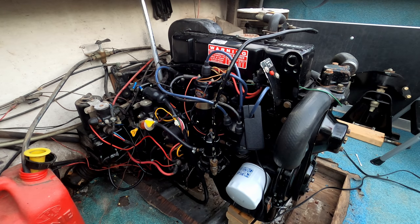So you guys can take that with a grain of salt, do with that information what you will, but I will put a 12 volt to this thing because, like I said, it's supposed to have 12 volts going to the coil. You're probably not getting as much spark to the spark plugs as you'd like. These spark plugs are not gapped any wider than factory. Just because you have a hotter ignition, you do not open up the gap.